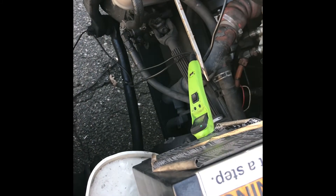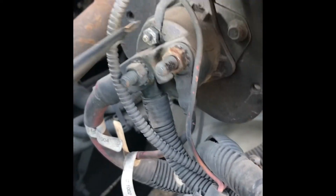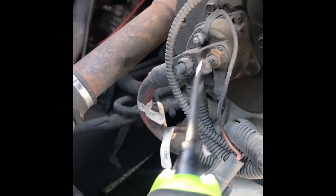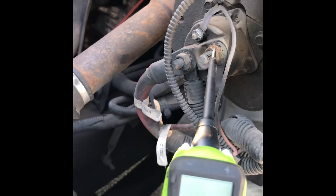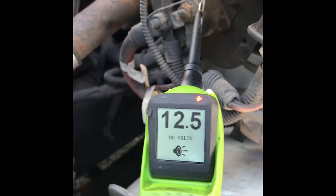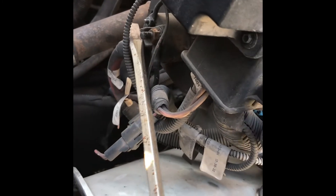We're getting power — whenever I hit the ignition we're getting power. So we know this solenoid is getting 12 volts when I hit the key, but it's not cranking. So essentially this solenoid is probably bad. What I'm going to do is hit 12 volts to this lug which goes to the starter. If you have a power probe, hold it in power. If you hear the starter clicking, it just tripped the breaker.